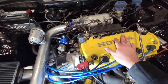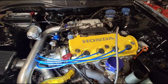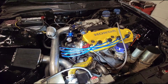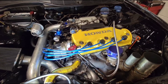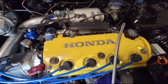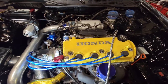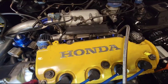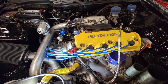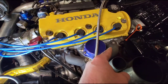Do I recommend decapped injectors? Absolutely not. Some people say all the injectors are the same Bosch-style, but that's where quality control comes in. Look at top injector companies like Fuel Injector Clinic or Injector Dynamics — look at the quality control they have. They'll take a hundred sets of injectors and make sure they all flow the same. Ones that flow slightly off — say 970 CC's instead of 1000 — get batched together. Without that consistency, as a tuner you're going to see a rougher idle, inconsistent partial throttle, and inconsistent air-fuel readings, with no way to tell cylinder by cylinder without a wideband on each pipe.